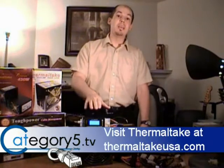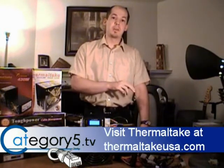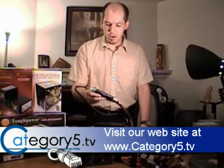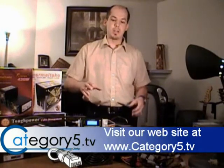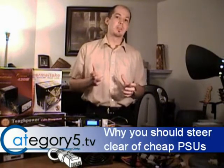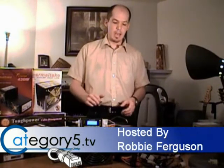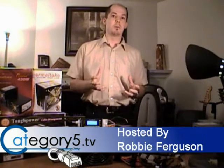Now, just to explain what the PG value on the power supply tester means — when we were testing the 300 watt power supply we were seeing values in the 900s, and that was setting off an alarm. Here we've got a nice value of 370 and no alarm. What the PG value means is that your power supply is set to only turn on the computer when there's clean power being driven from the power supply. So this power supply, within 370 milliseconds, is going to be able to get up to power and start generating clean power within that amount of time.